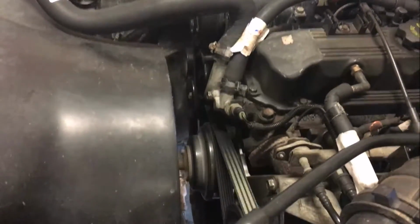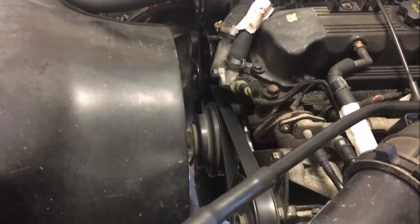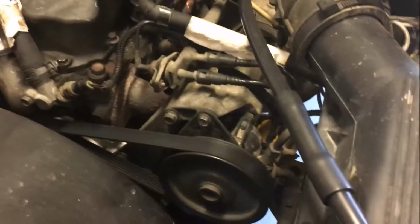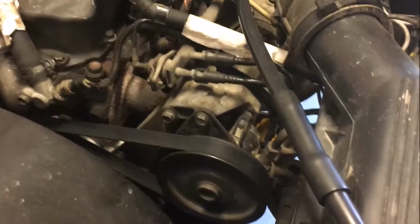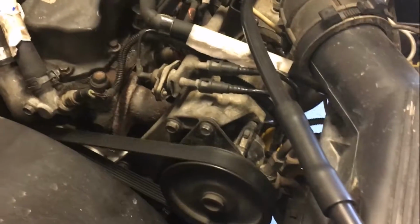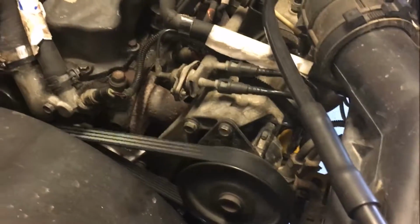The little patch on that belt was just enough to get a little squeaky on me. Also getting this tightened back up nice and tight. And one of the things I've read a couple of things about is that you just have to go tight, and then a little tighter, on these belts to make sure that they're good. I know on some other cars they like them a little looser, but these seem to really like to be tight.